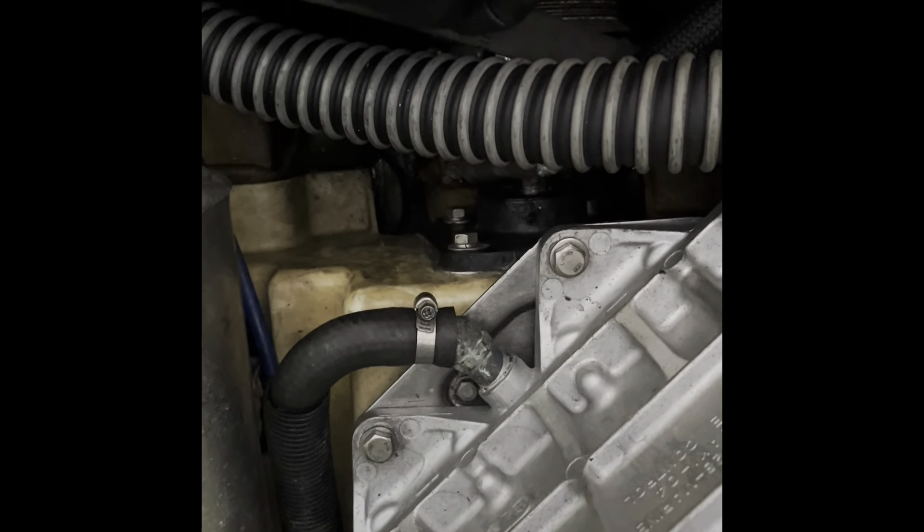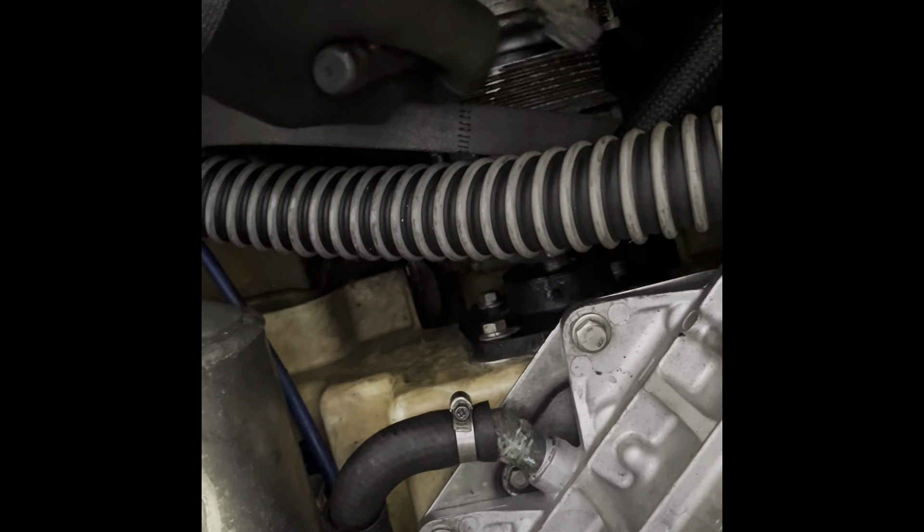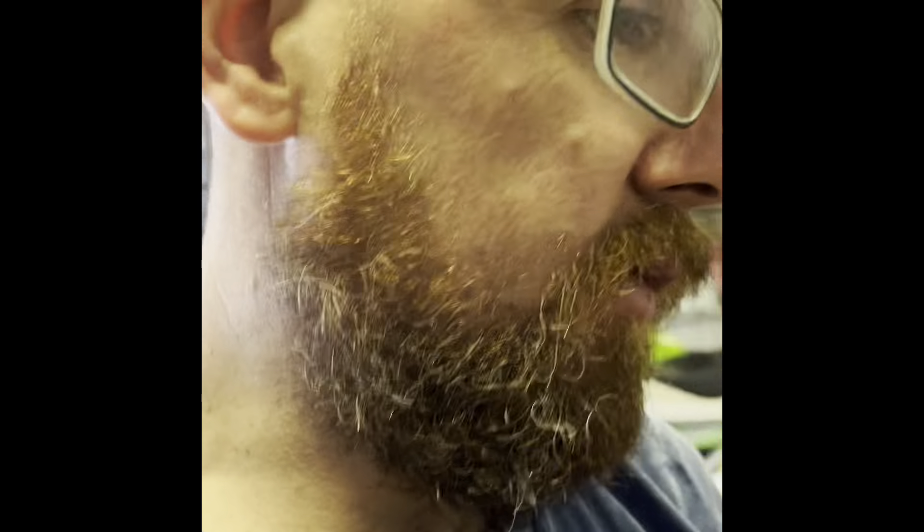Something stupid I've done — I was taking that manifold off and it's got these little stainless washers. I've actually dropped one down there into the third cylinder. So I'm going to mark the crank — make sure we don't turn it until we get that washer out. Just put a little mark there. I don't want to be turning the engine over if you've got anything underneath the valves. I literally pulled the manifold up and that little washer just slid in — heard it tapping. I can feel it with my finger. I'll just get a magnet and scoop it out.